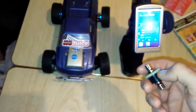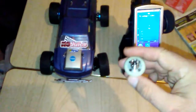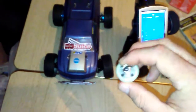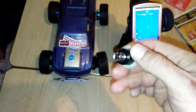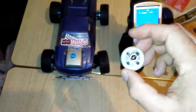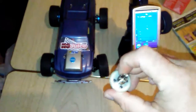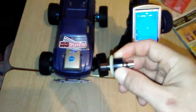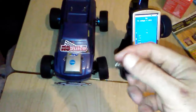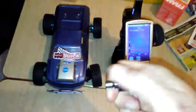So I decided to take a look at the diffs after I changed them, and the first thing I noticed was the screws were really loose — all four of the set screws. I cracked it open, looked at the gears, and nothing looked damaged to me. I thought that was kind of weird, but I put it back together and tightened those set screws up really well.